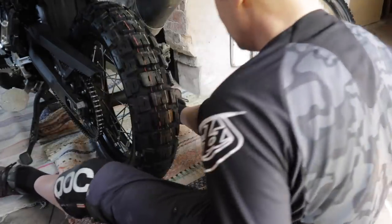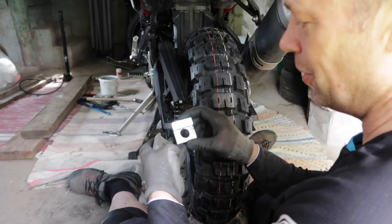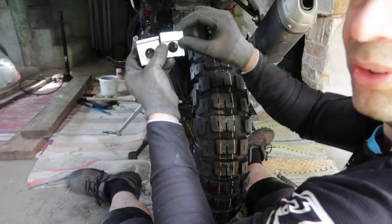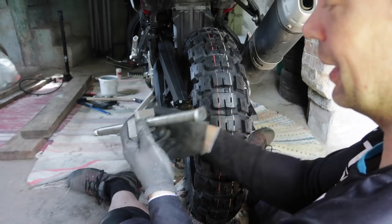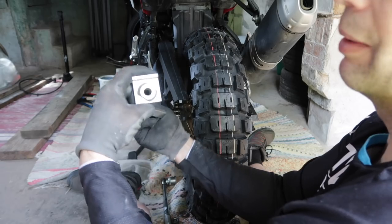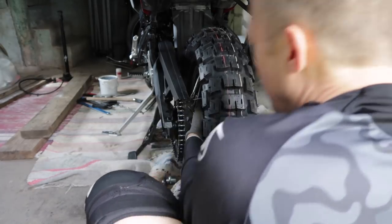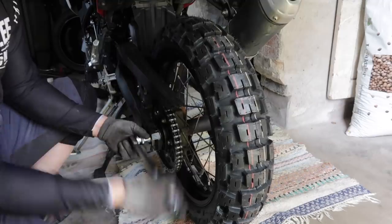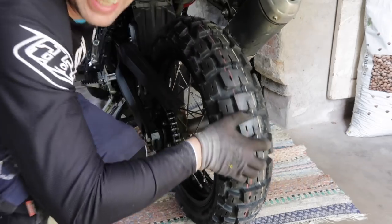On the right side, take a screwdriver and separate the brake pads a little bit, carefully. Make sure that you have the correct distance on the correct side. As you can see, this one has a much thicker part, which is intended to stop the end bolt from rotating when it goes in like this. I have made that error: if you put it on the other side, it will rotate when you tighten the nut. And get that there. We have it. Happy days.